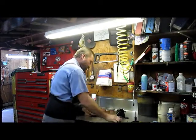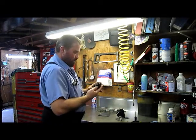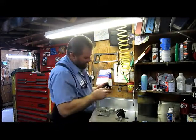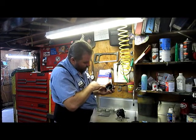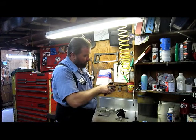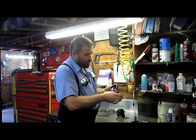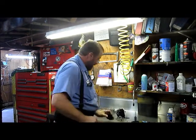I'll wipe a little dust off and do this one more time. I can see the sandpaper has contacted all the way across — barely contacting that last spot. I'm going to call that good. That is as flat as it's going to get, and you don't want to go too far because there is a little raised ridge around here that aids in the gasket sealing against the actual carburetor base. You want to leave as much of that ridge as possible.